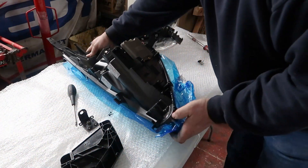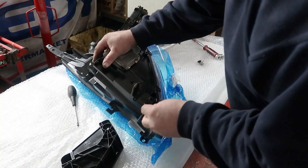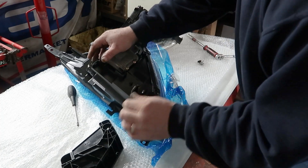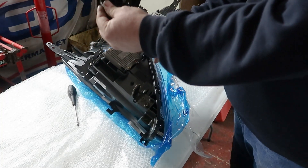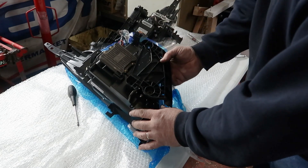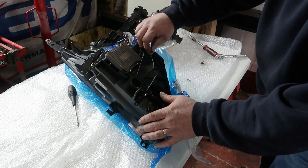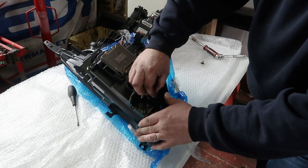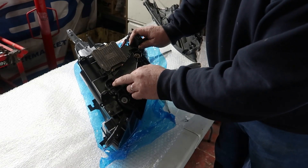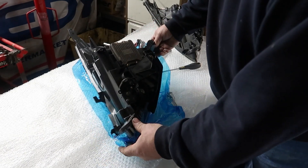This is the new unit. This piece just pops back onto there — reuse the screws. Now when you remove this bit, you remove three screws, but you're only going to replace two because they've decided to put a plastic lug in here, which makes it easier to lock it in place. Just pop two screws back in and do those up. You can see it's got a little locating plug there, so two screws and the two screws back in for the headlight mount, and that's pretty much ready to go back in the car.